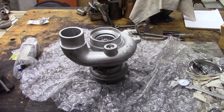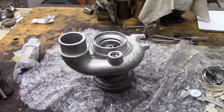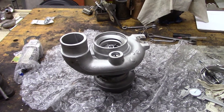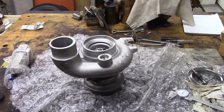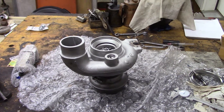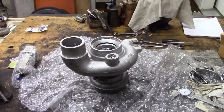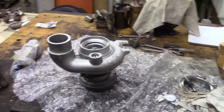Because there isn't enough boost, and the motor is fueling for more boost because it was used to the previous turbo. There's too much fuel for the amount of boost, it smokes, the EGTs are hot, there is no boost at all — or there is some, but the boost never gets up to where I want it to be, around 30 psi or so. It was just an awful turbo. Bad decision.